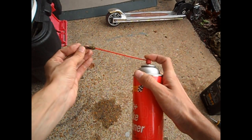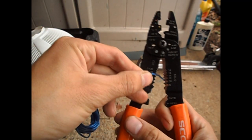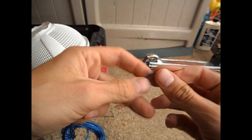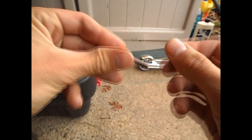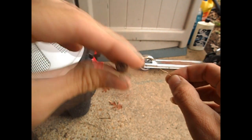This one here is not coming out properly. That's got it. And of course do the same thing for your pilot jets. Looks like that main hole is a little clogged up on this one. But yeah, you get the idea — just keep going until all the holes are clear. Just to make sure we got all the holes poked out, strip this wire here, just cut it. Now we have all these nice little thin pieces of wire to work with. Just stick it through every one of the holes. Then I'll spray it out one more time real well. Yeah, it's nice and clear.